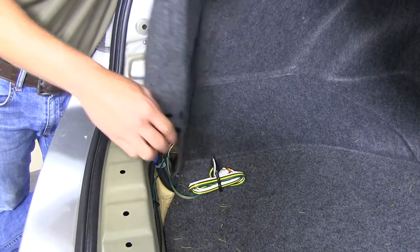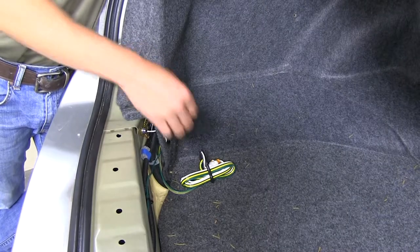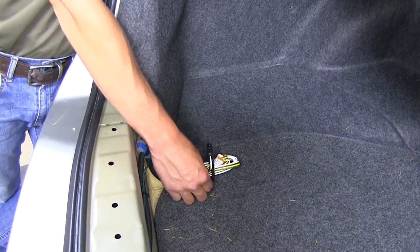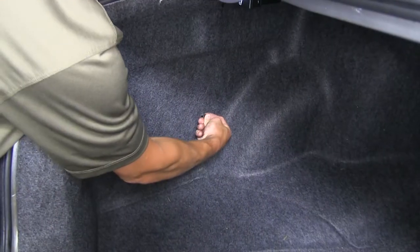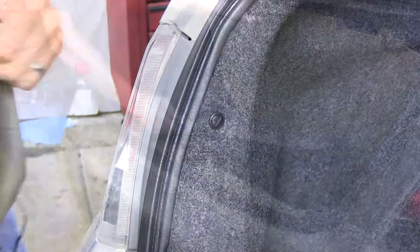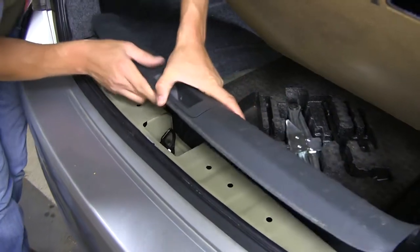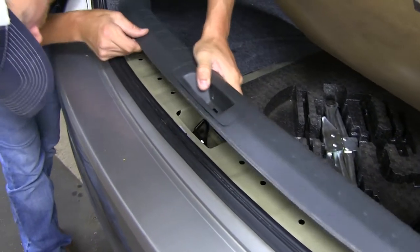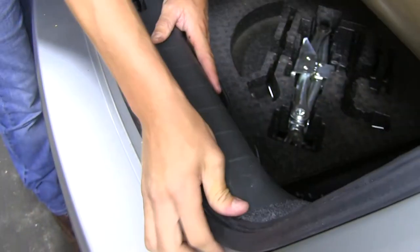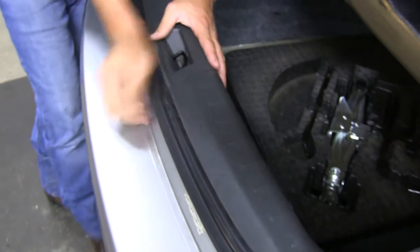With everything cleaned up, we want to be sure to leave our four-pole connection on the outside so we can connect it to our trailer. I like to use the dust cover to keep everything bundled up and nice and clean. We can go ahead and reconnect our carpet and put our threshold in. The trick here is to get everything lined up and line up the holes underneath. Also be sure that the weather stripping is back over the top of it all the way across.